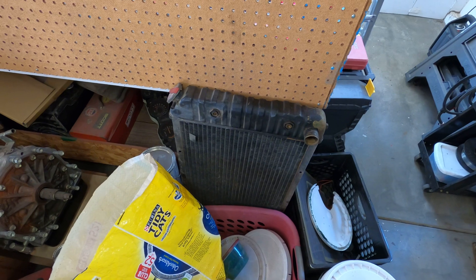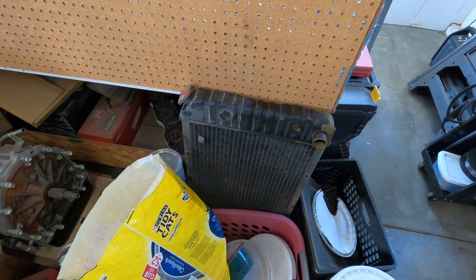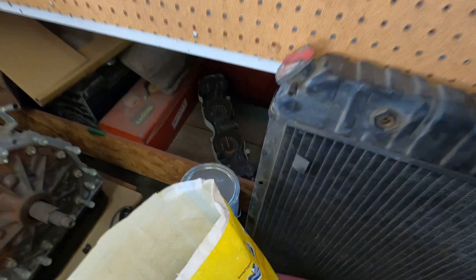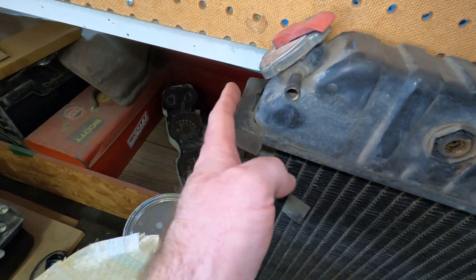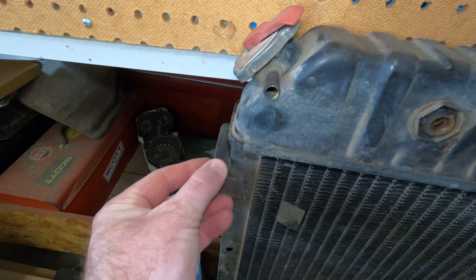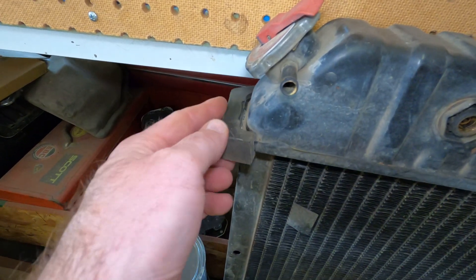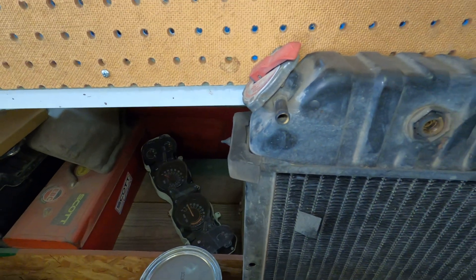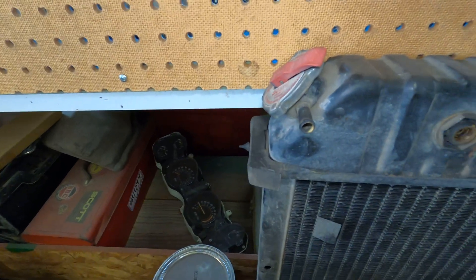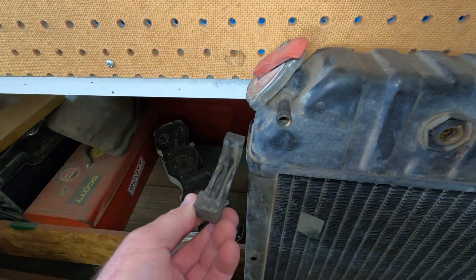So I was trying to figure out why our isolators don't fit the new radiator as good as the old one. I got the old rubber isolator and plopped it on here, and it's designed to fit on the seam of the tank — not just where the fins are, but to actually hug that seam. It's shaped perfectly for it and fits perfectly. So imagine that in all four positions, top and bottom, left and right. That's how it's supposed to fit.